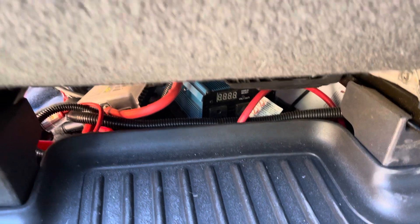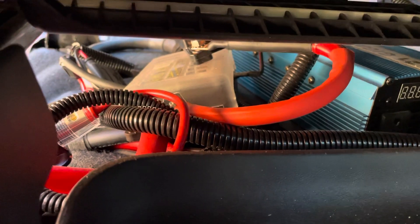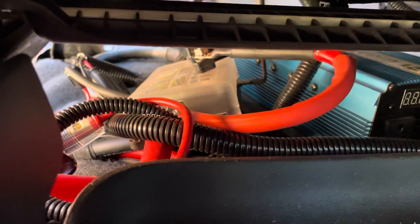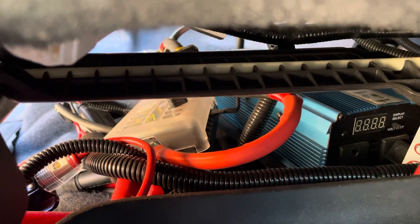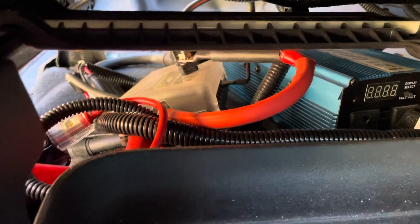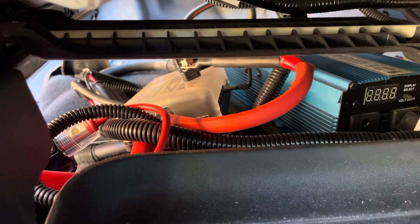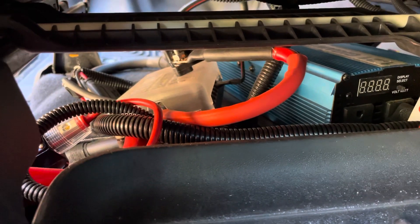The DC is wired to a fuse block — the part number is in the description. What I did is run zero-gauge wire from under the hood to maximize current capacity. Based on the distance of the cable, I'm rated for 300 amps, however I have a circuit breaker in-line that limits it to 200 amps, which should be plenty — that's a lot of DC current. It runs to the fuse block, and I've got two-way radios and all sorts of accessories connected there.